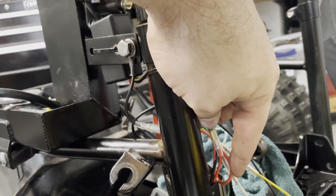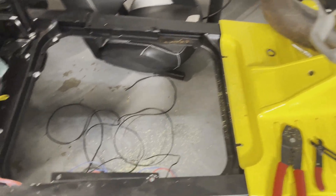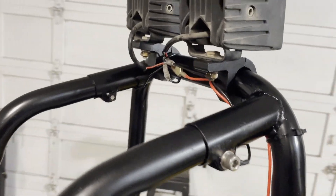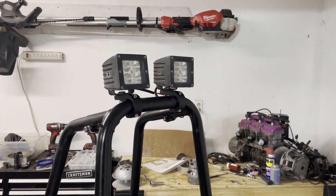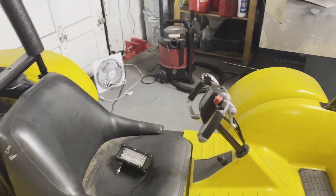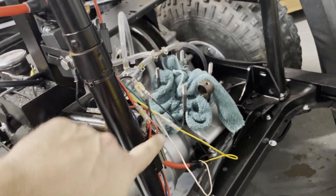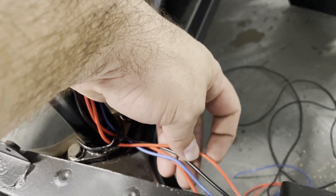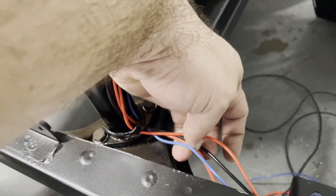Also coming out of that fused circuit I've got another red wire that's going to run up to the light switch. I probably should have used yellow or some other color, but coming out of that is another red wire going through the chassis all the way up to the lights — those are tied together at the top. Maybe eventually that'll be the high beam and I'll put a low beam on the bumper. Coming off the starter solenoid I've got a blue wire running down the chassis, and coming off the coil I've got the black wire for the kill switch. The 12 volt positive goes to the headlight switch and also to the starter switch button, black goes to the kill switch, the other red goes up to the lights, and that blue goes to the starter solenoid.